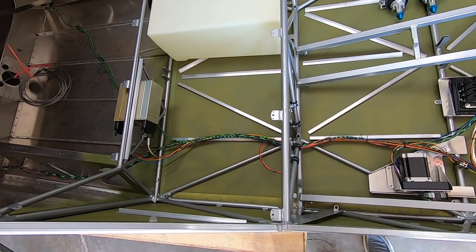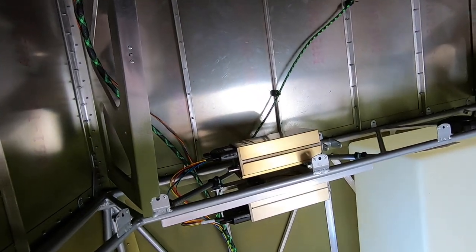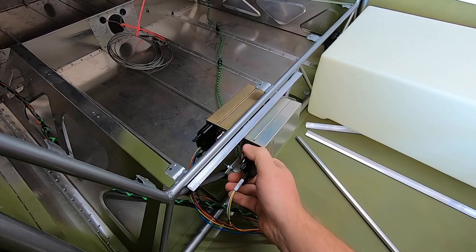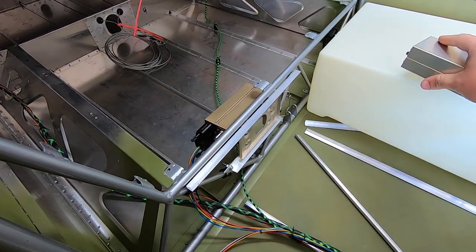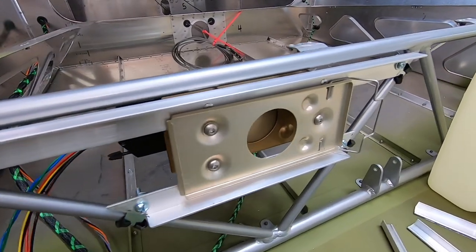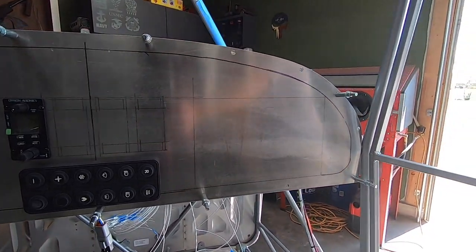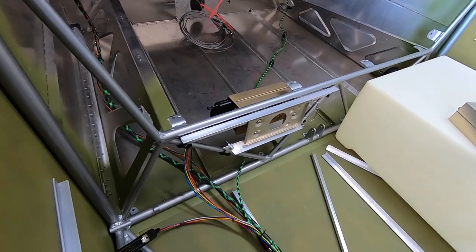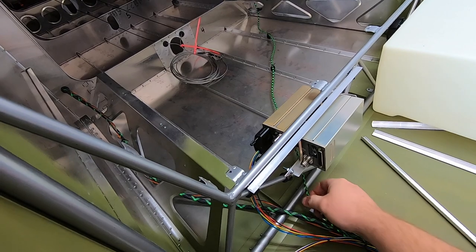As for installing these parts in the aircraft, I've chosen to locate the remote radio back under my baggage floor next to the transponder. They look a lot alike, but the radio is the more golden-colored one. I'll take off the transponder just to show you how easy it is, since the radio works the exact same way. I secured this mount to the tubes using cushion P-clamps and it worked out very clean in my opinion. Not all the wires are in place here but you get the idea of how things would lay out. As for the control head, apart from being a bit of an odd shape to cut out, it's really not a difficult task at all. Dynon has a very good video detailing the functions and use of this radio, so I'll link that in the description — I think you'll find an unmatched user interface with a very usable set of features for the everyday pilot.